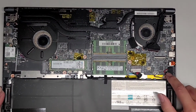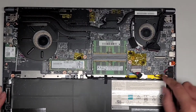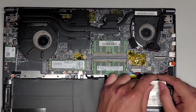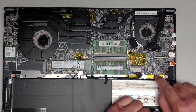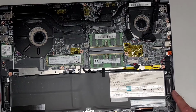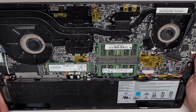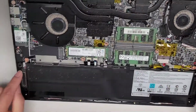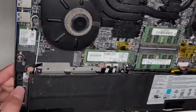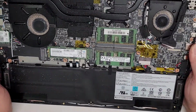Okay, you've got the BIOS CMOS RTC battery underneath this piece of tape here, and most likely it has these kinds of connectors like the speaker connector. These ones are a little bit easier with the actual wings on them. Anyways, there's the speaker connection here, and most likely there's a wire that runs along either underneath or on top. Let's see here. Okay, it looks like there's a black and red wire for this speaker that runs along underneath the battery over to this speaker.